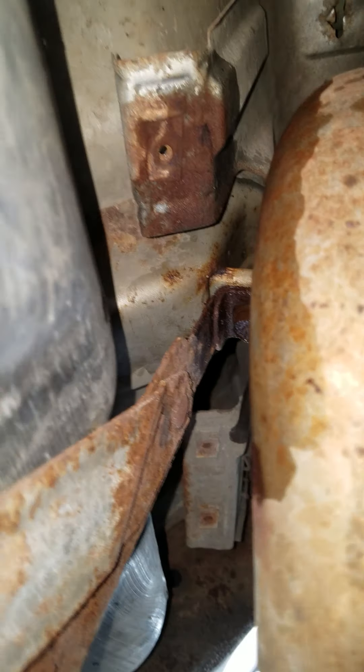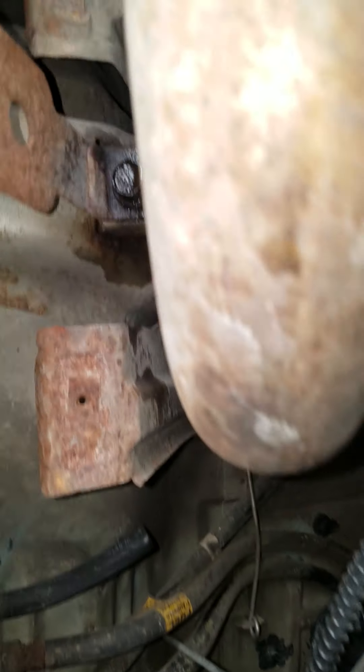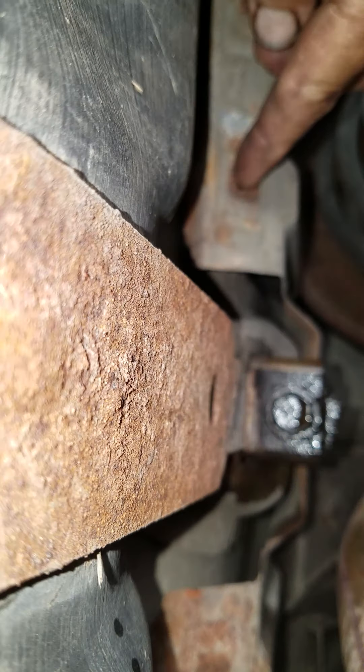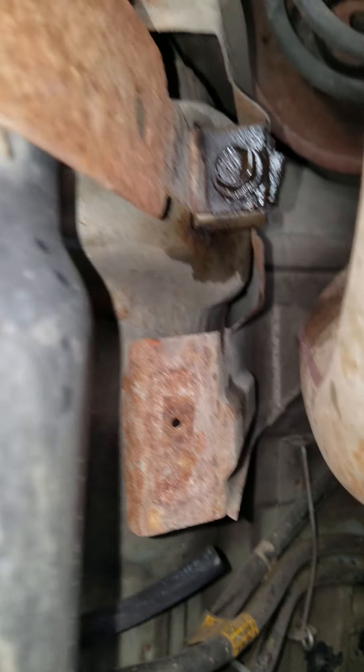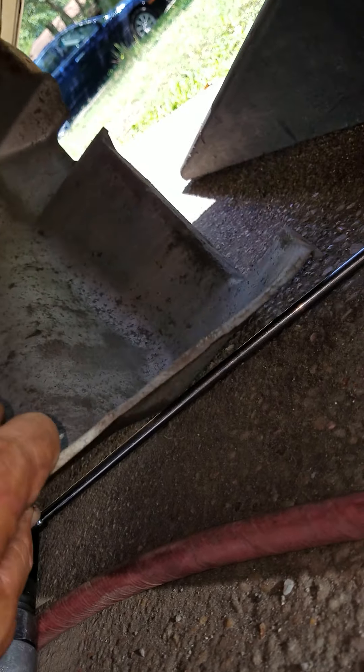Whenever you want to drop this fuel tank, take that bolt out right there and put some oil on it. There's another bolt there, and as you can see there are some bolts missing here and here. There's a heat shield that goes right here on each side — here's the passenger side heat shield. You just take those heat shields off with a seven millimeter and get the heat shield out of the way.